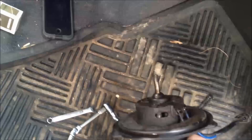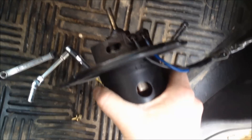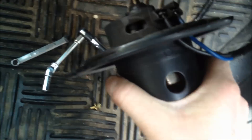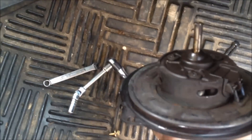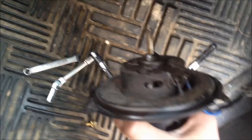I took the cage off and hooked it back up, and I think the motor is done. There was so much graphite that came out of this thing from the brushes. It still works, but I just realized the fan only works when it's all the way up, so there's something else wrong here.